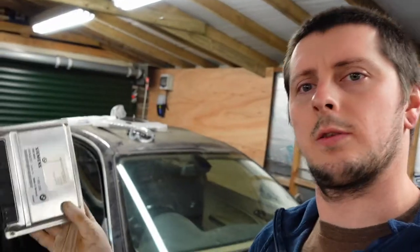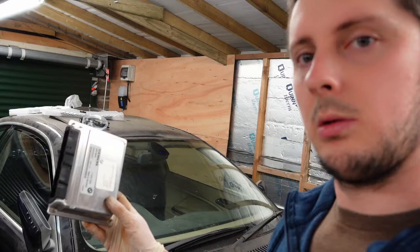That's it. So the reason for removing the ECU is the factory ECUs have an EWS system built into them. So for example, with this now, it hasn't run since it's got here because I disconnected the battery to save the charge in it, and it thinks it's having a battery changed. So then you need to plug the car into a computer, tell it it's having a battery change before it'll start again. It's like a safety feature, which is annoying for the purpose I want to use it for anyway. So there's a company on eBay, I'll put a link in the description. Basically, they do an EWS delete.